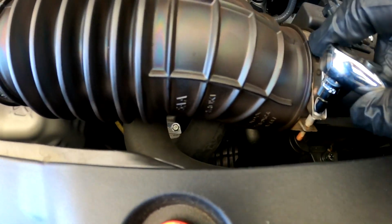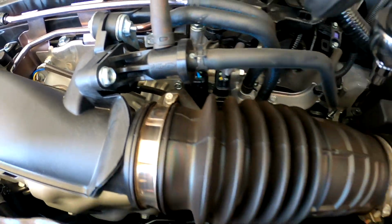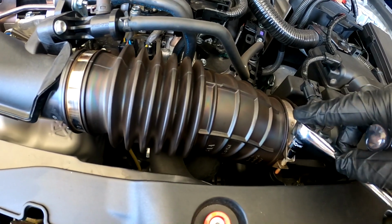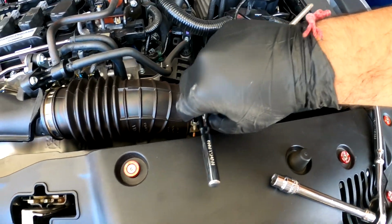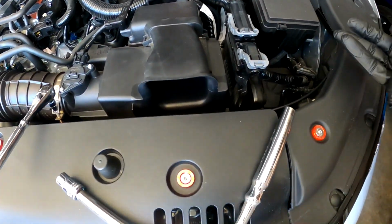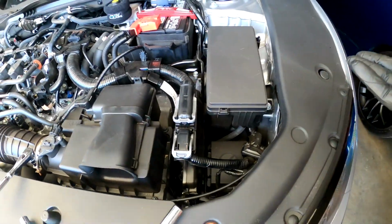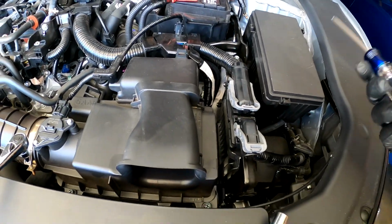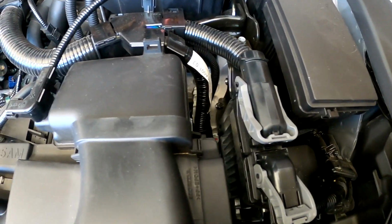So this one right here, I got it as a 5.5 millimeter, and there's one right there too, 5.5 millimeter. Fits snug, perfect. I like using metric, because in Japan they basically use the metric system. So of course you want to use metric to take off any bolts. They always say you could basically disassemble a Honda with a 10, a 12, and a 14 mil, maybe a 17 also. You get me? So let me do that. I'm removing that bolt all the way down there, then this one right here, and then I'll pull it all out.